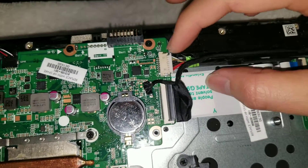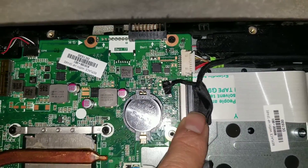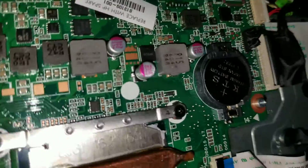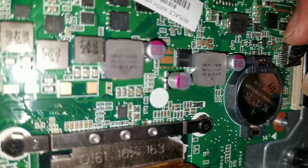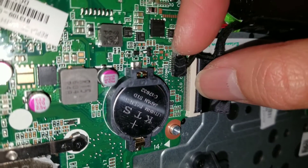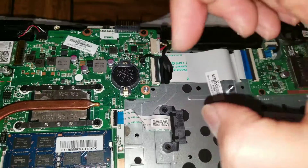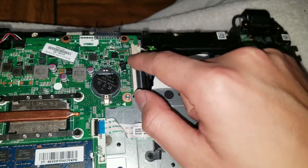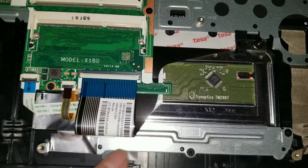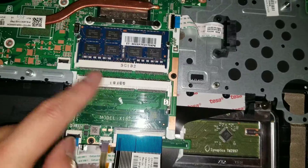To remove connectors, there are little tabs that stick out — just wiggle with your nails until it comes out. This is the LCD connector, which has a little flip-up latch. There's another connector which is for either the webcam or touch screen — this one just pops up. Get your nail or a small tool under it and wobble it up. Don't pull too hard straight out because you can actually rip the socket off the board. The trackpad is here with some adhesive — to remove it you'd have to take all of that out and actually take the whole motherboard off as well.